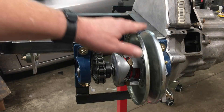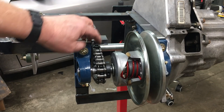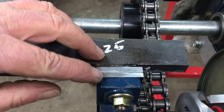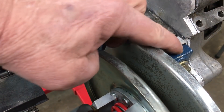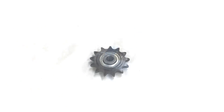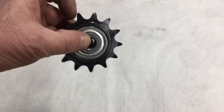So this is what we ended up with. I still need to do some clean-up work on the right-hand side, but for now we have enough open space to work things out. The chain is actually fairly tight, and that's because I made up some aluminum shims to move the jackshaft bearings out about three-eighths of an inch. Shims will definitely work for the basic adjustment, but we still need to deal with the chain slack. We're also going to be using an idler sprocket to help maintain chain slack.